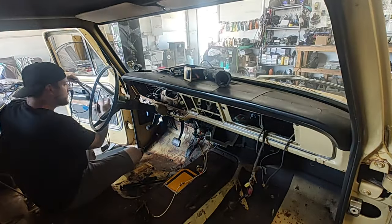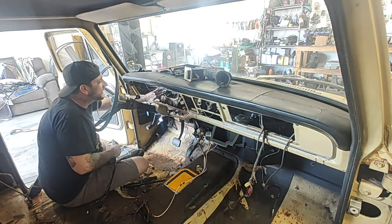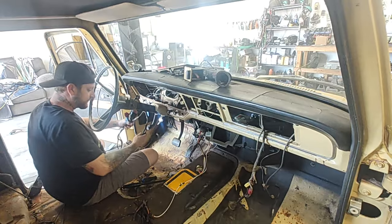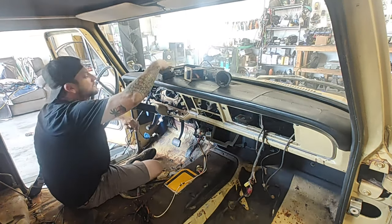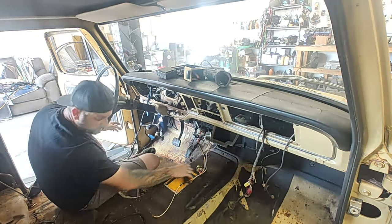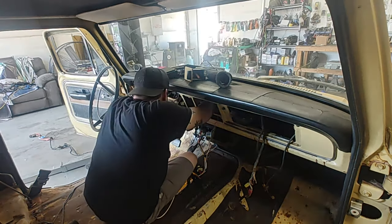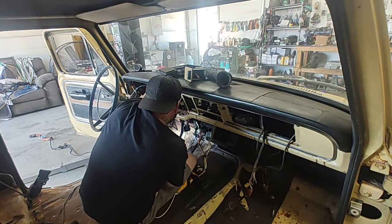I'm going to come in and try to fish this stuff in with all the other wiring. There's a metal thing right here that goes behind where your gauges go — I'm going to try to run this in behind it because we've got a lot of wiring to run in here. I'm going to unhook this power steering control module for now and we'll plug that back up. Don't forget, it's by the plug that's next to the AC box. Watch out for your windshield wiper control arms up in here — you don't want your wires getting tangled up in them. Once we get it all done, I'll zip tie it real good and tight into the metal bracket so we know it's not going to get caught up.